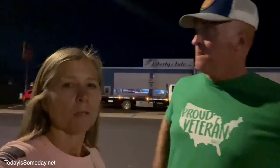I drove the car this morning when I went for my run. I drove it up to another parking lot to run, and there were no problems at all. We had to put it in the sand gear, because we were on some pretty soft sand where we're at. And I don't know if something didn't engage right, or didn't disengage. But all of a sudden it started bucking. The electronic stability control came on with flashing lights. The check engine light came on, and then we were standing outside, and I popped the hood. We checked the fuses and made sure everything was good. And I just happened to look down and saw the leak under the front of the Jeep.